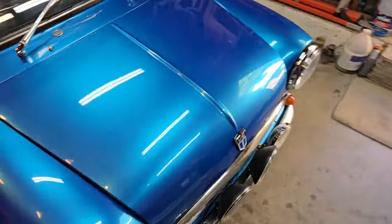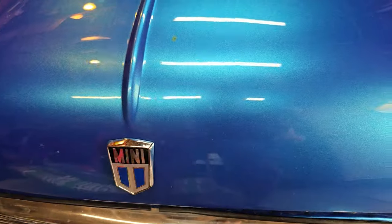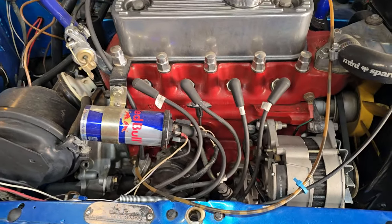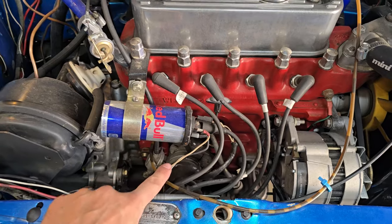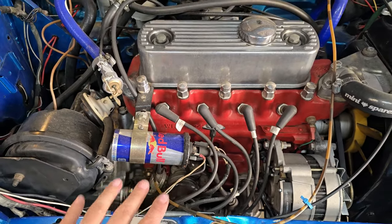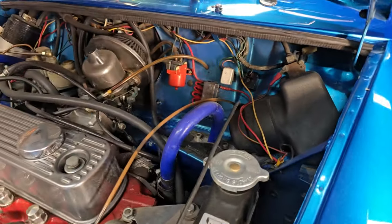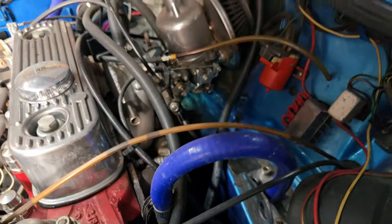Let's see what's under the bonnet here. Some LED rally lights. Under the bonnet we've got a 1275 A Plus high compression motor with a 65D ignition system. I'll probably have a quick check here, but this car is running fairly well so hopefully nothing too serious. Pretty standard stuff — HS4 with a waxstat.